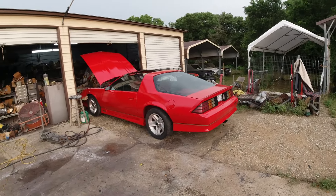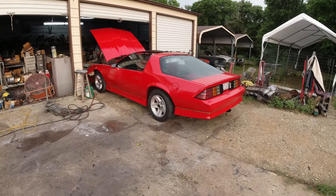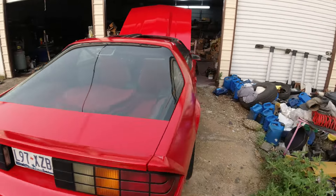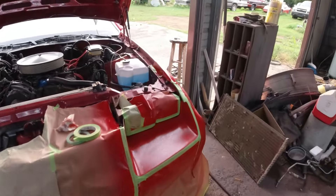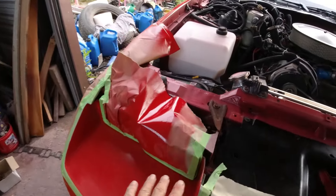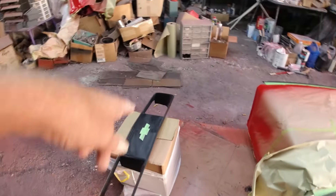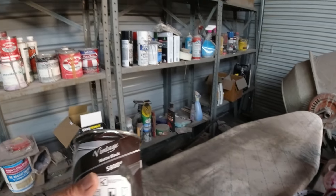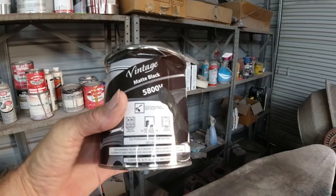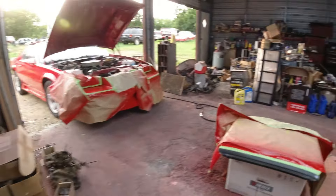Just about to get dark but this is it — just stopped raining about an hour ago, first time it's been outside. Hopefully get a nice sunny day the next day or two before I finish this video so we can see it outside and go for a test drive. I sanded and masked this area — going to paint the edges of the T-tops and the grill matte black. Got this matte black from my local paint store with just a little bit left, enough for this job. Need to add hardener — I don't have the correct hardener so I'll use some from the red paint.